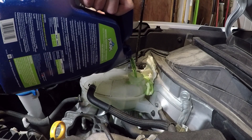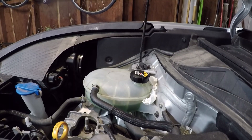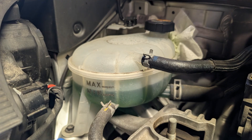We lost a little bit less than a gallon in this process, so we're going to have to put that back in little by little. You can see me filling the reservoir and then starting the engine — the engine just gobbles it up immediately. You're going to have to repeat this process a few times. Even after getting close to full in my garage, I continued to monitor for the next three or four trips, and each trip I did have to top off a little until I stayed consistently within the min-max marks.